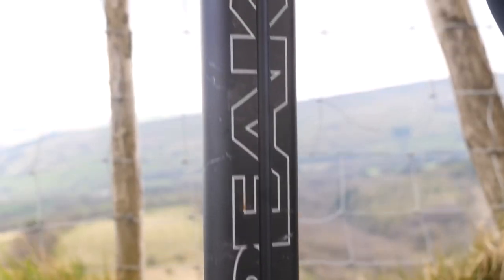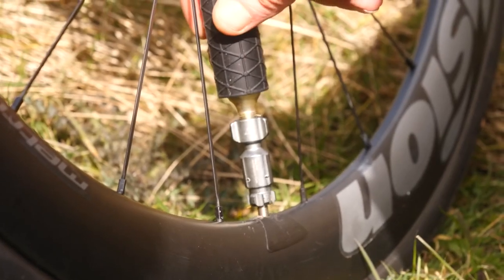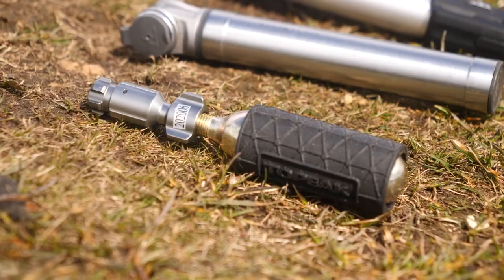It's pretty much all down to when you pump your tires up. Depending on the quality of the pump, it can sometimes be quite loose and it can cause bending — it is pretty normal. You can just bend them back, but you need to be extra careful. Over time, you do run the risk of them breaking if you keep bending them back, which means you'd have to replace the valve core. Just be careful when pumping them up and keep an eye on it.